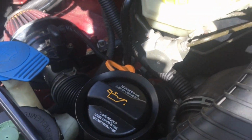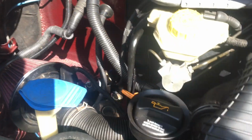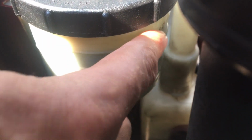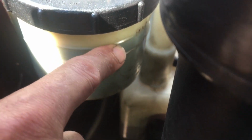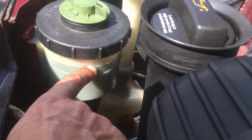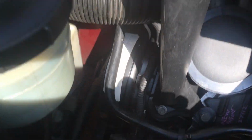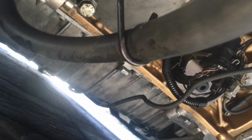It's a mixture of oil and all the gunk, and because this power steering pipe that runs from the actual reservoir down to the pump is a double layered pipe, what's happening is this lid isn't sealing properly, and this fluid here, because it's at the top, I can see why they used to run it before at the bottom, and never used to fill it all the way to the top. That reservoir used to be half empty, and it's because when you're accelerating and braking, it swishes backwards and forwards, and then it overflows, and it runs down the inside of the pipe. So all of the crap that's inside of that pipe, it washes it all out, and so I've got power steering fluid coming through and then dripping off this little bracket here.